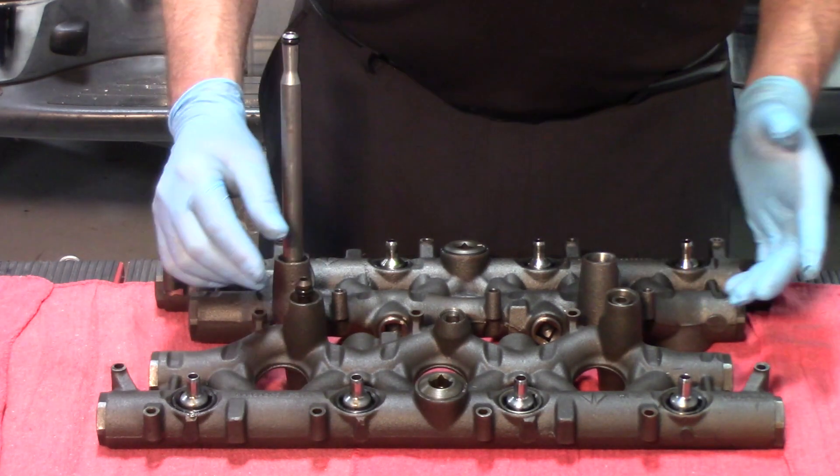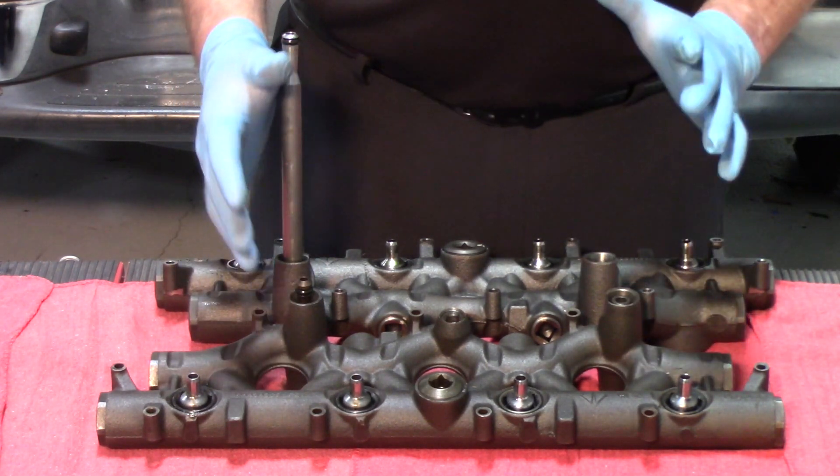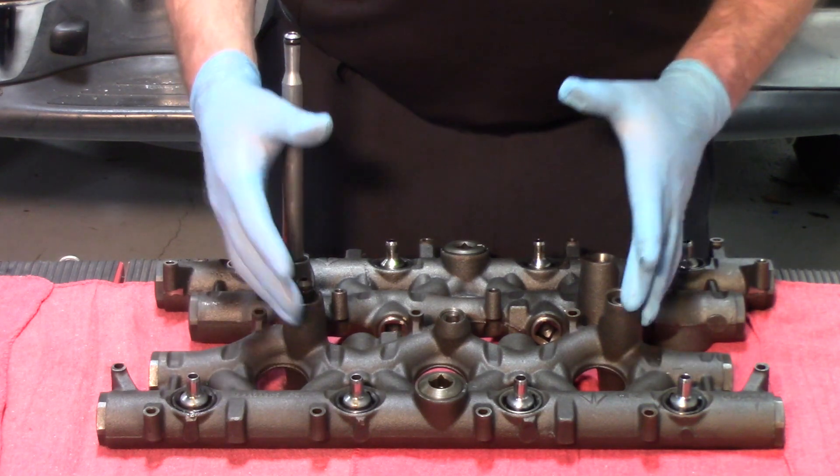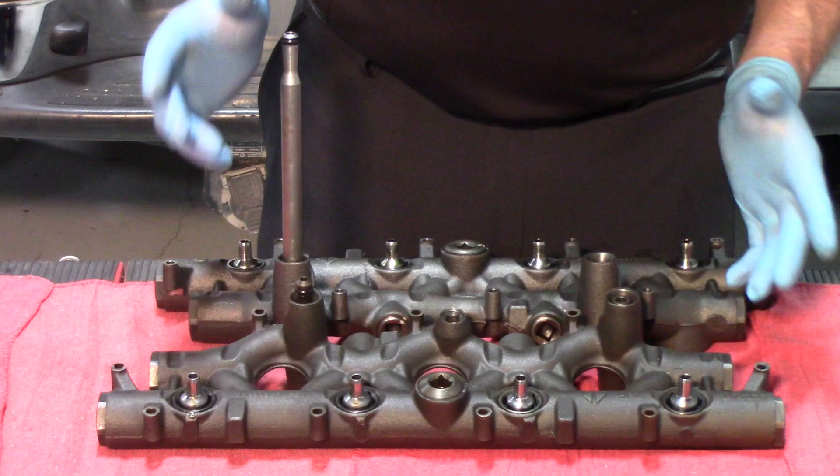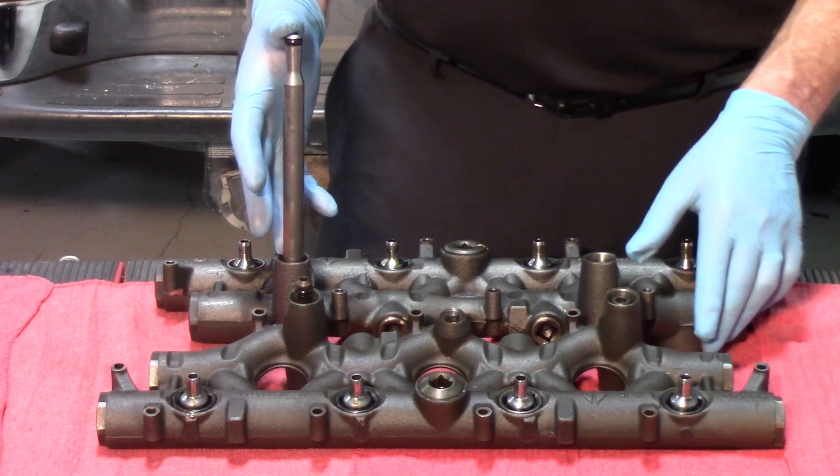The reason we show you that is one of the common issues with these engines is lack of oil pressure to actuate the injectors. One of those problems is with the stand pipes and dummy plugs.